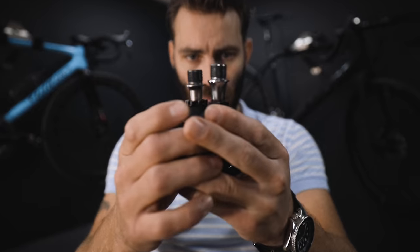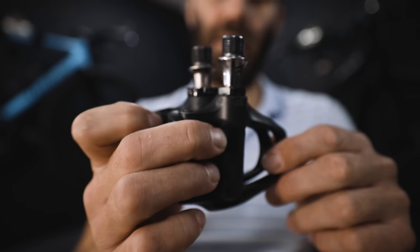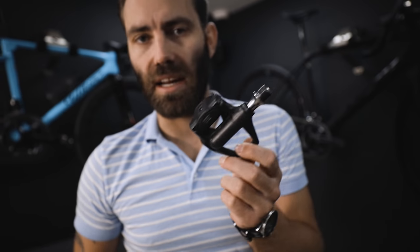There are also various pedal systems that are wider or narrower. It's worth noting that the Dura-Ace pedal from Shimano is narrower than the Ultegra, 105, and R550 — every other pedal in the range is wider than the Dura-Ace, including the long-axle version. Shimano also makes a long-axle pedal with a 4mm increase, which is my best-selling pedal system at a rate of about 50 to one, because many consumers need a slightly wider stance in a market where stance is always being reduced. Look doesn't make a long-axle version but has a slightly longer thread, allowing more spacers.